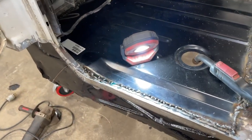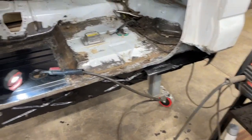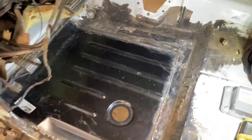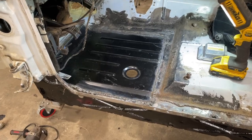We've made some pretty good progress — we just got this left to do here and up back in here, and then we'll be done with the floor pan. We just got to grind down the welds and then next we'll get the rockers and cab corners welded in and start on the other side. Finally got it fully welded in there — they aren't the prettiest welds but you won't see them and I'm going to grind most of them down. It's finally nice having a real floor pan instead of a metal plate self-tapped in.